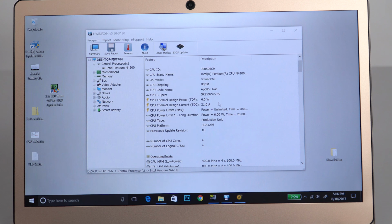So what this little tweak here does is it's using Read-Write Everything. So we're reading part of the memory, we're adjusting it, and what we are basically doing is lifting that 6 watt limit and making that a 10 watt limit, or even 15 if you wanted to. There's more risk though, because it's going to generate a lot more heat. But in turn, like the Chuwi Top Air that I reviewed, the performance really does increase, because it will then be able to hold the GPU clock of 700 megahertz that it has on there.